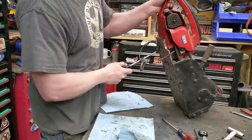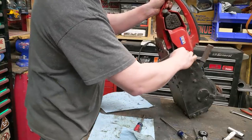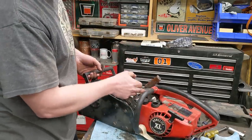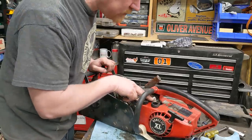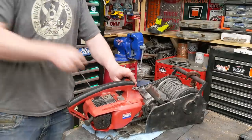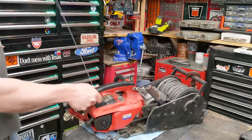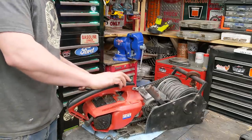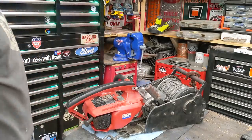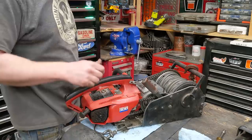We lucked out on the engine, mainly because of the no-ethanol fuel. Got that little air filter just jammed in there — it kind of wedges in there. I'm sure there's some sort of plastic cover that covers this whole area, but it's no longer existent; probably find one on eBay. Fire it up — turn it on, half choke. I drained out all my fuel. Oh, it's flooded now. Oh — I don't have a spark plug in it. There's your problem. Spark plug installed. Take two — the cylinder's probably full of gas now.